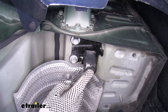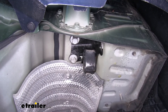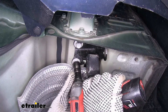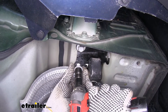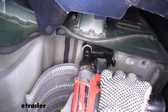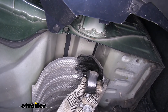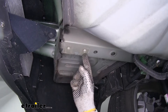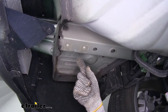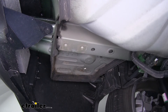Now if we look straight up right at that isolator, it's going to have a bracket attached to it with two bolts. We'll still use that 17mm socket and we're going to pull that whole bracket out. This time, we are going to hold on to the bracket and the rubber isolator. So we should have two weld nuts on each side of the frame where we pulled down the tie down hook and our exhaust bracket — those are going to be the four mounting locations to put our hitch up.